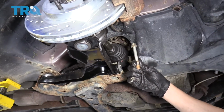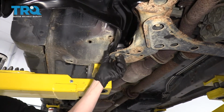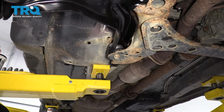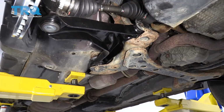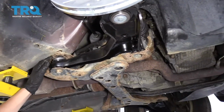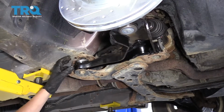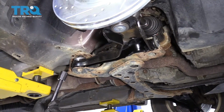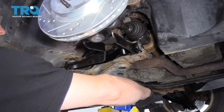All right, there's one more bolt out. Over here we have another control arm bolt. This is the biggest of the three, so it's going to probably be the toughest to take out. Obviously we have a new control arm here, so it's going to be easy for us. For you, you may want to spray some rust penetrant up in these holes because you'll get some lubricant on the threads. So we're going to use this 21mm socket and a 1/2-inch breaker bar to get it loose.